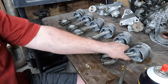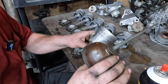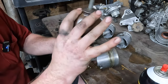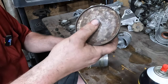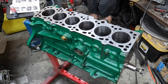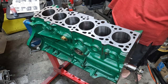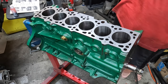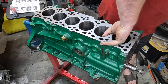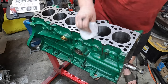In here is the first jug of Rotella I found — I think it's T4 10W-40. Not like it matters as long as it's wet and slick. Time to put the pistons in. Before I do that, I'm going to wipe the cylinder wall down with a lint-free rag. Dryer sheets are the cheapest lint-free rags you can find. I'm also going to wipe down the cylinder head surface — the MLS head gasket needs the cleanest possible surface to mate to. A word on honing: I didn't have to hone this block because it was done previously; if you were going to hone it, you would have to take those oil squirter nozzles out.